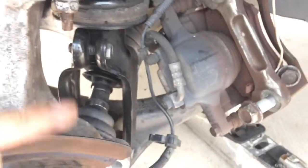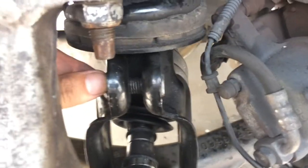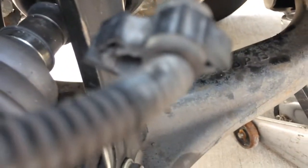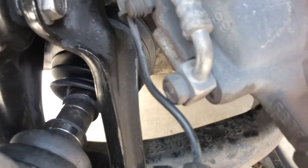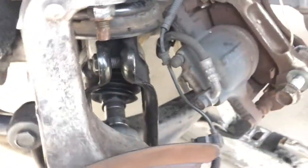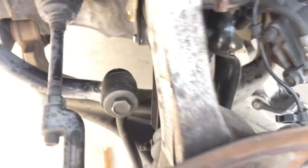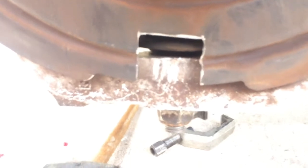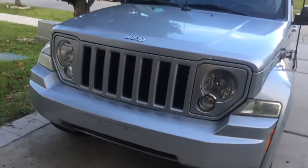To summarize, I had to undo the top and bottom ball joints, tie rod, clevis top, and clevis bottom - that's five connections total. That gives you enough room to do everything. And the window that I cut is optional - if you want to take the wheel hub apart that's fine, but I did that to remove the bottom ball joint. All done with the front end.